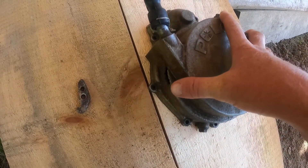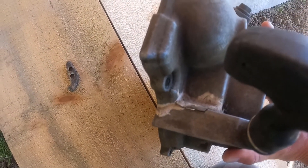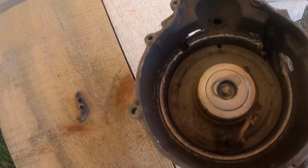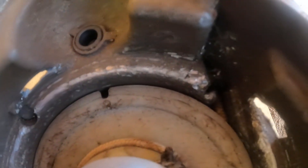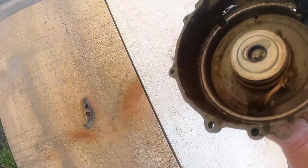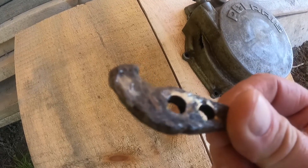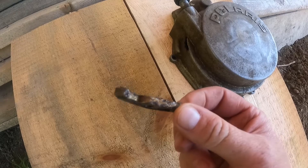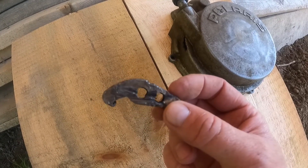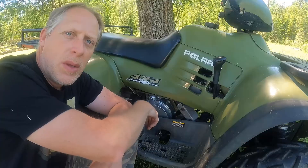Here's a shot of the original stator and recoil cover — as you can see, there's a nice hole right through it and some cracked pieces at the very top, which was letting in moisture quite badly. On the inside it's quite mangled and beat up. It turns out the cog that engages the starter pull cord had come off and was rattling around in there, just smashing everything to bits. When that dropped out I was like, well, that could be the root of a big part of the problem.